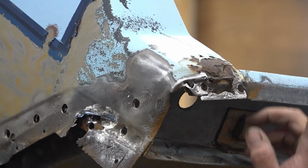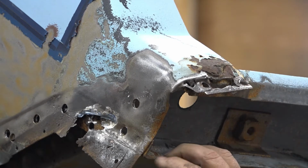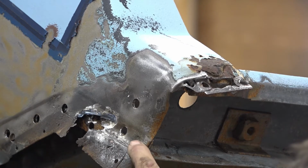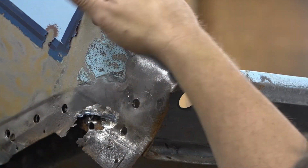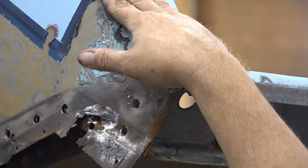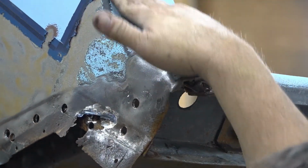So we've got our 2 spot welds out here. And oops, I missed one. Look at that. But we got all the rest of them out over here, and this is away. So I'll get this last one out, and then we're going to cut right along this line, this change in body line. So it'll be a little bit easier, I hope, to hide the transition there.